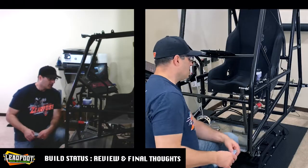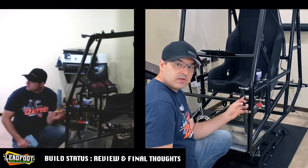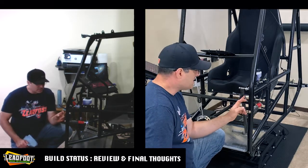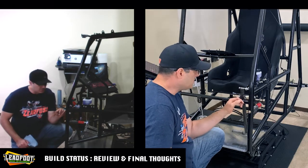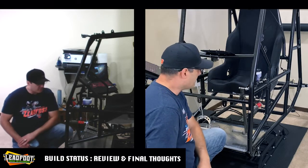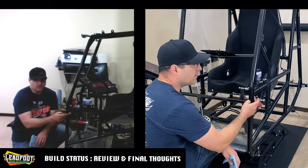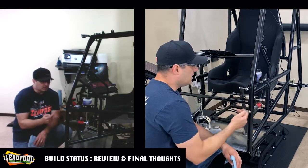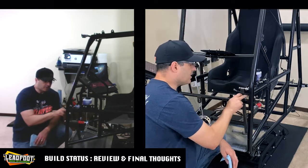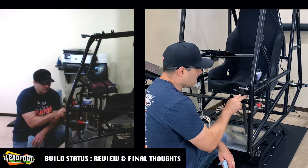Okay, so our main challenges that we ran into with the sprint car build is the mounting tabs for the brake pedal. I only have one tab. Normally you're supposed to have two tabs, and that makes bolting on this pedal extremely easy. Unfortunately, we did not have that, but there was a spud that was welded onto the side frame that was directly horizontal to the hole in our tab, so we ended up having to bridge this gap to add some rigidity to this tab here.